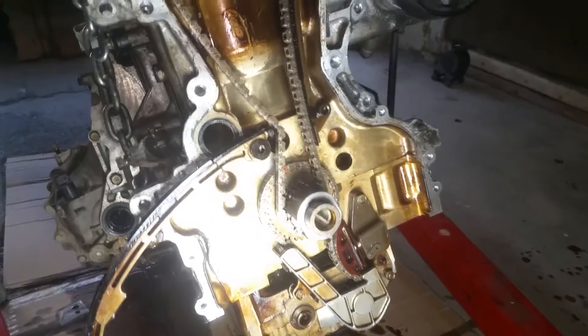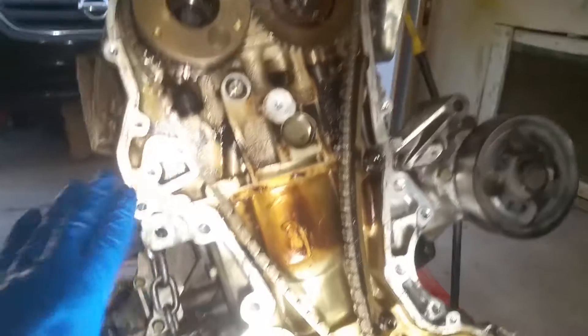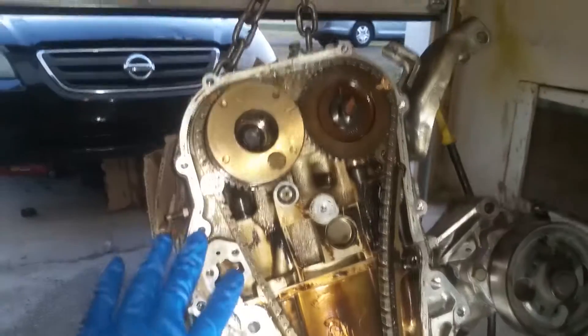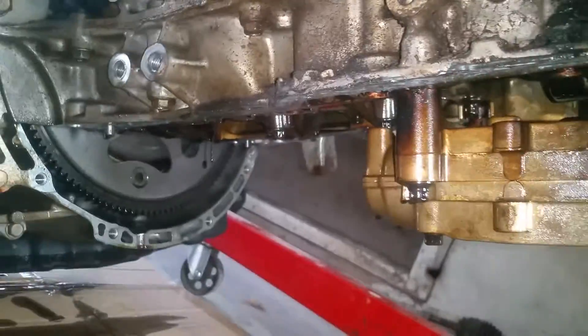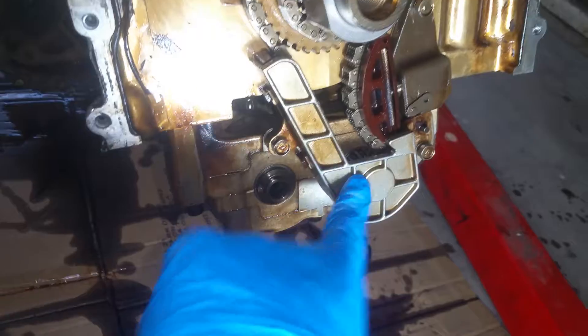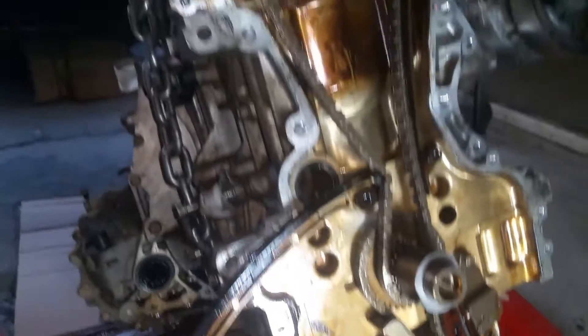The main thing is you've got to get the front cover off of this, and it is really no joke. It's siliconed on there, and there's some alignment dowels on there, and it just really sticks. Also, the bottom plate on the engine has to come off as well to be able to access this lower portion of this tensioner where you can see the alignment marks.